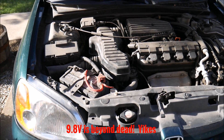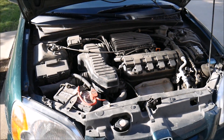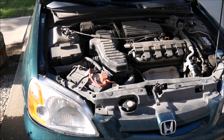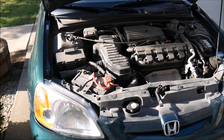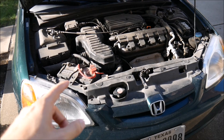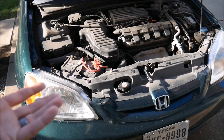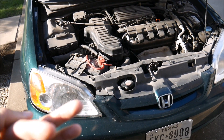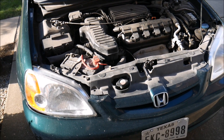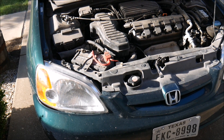What I want to do is test the repair function on this battery charger and see if it can work a miracle. I'm not really expecting it to, but you never know — if it is a genius, I will give it lots of credit. I'm going to hook up the Noco to the battery, let it run in the repair charge mode overnight, disconnect it in the morning, let it sit all day to rest, then test the voltage again later in the day when I get home from work, and see if it can actually start the car under its own power.